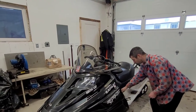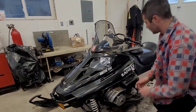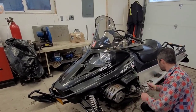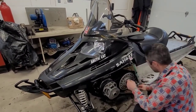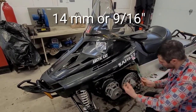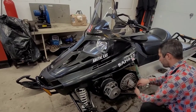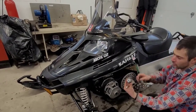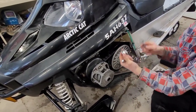So we're going to remove the belt, reinstall the new one, and shim it. Open up the cover — there are two bigger clips on the side here and this whole shield will remove. Put that aside. Then you're going to want to put the hand brake on here. With a 14mm or 9/16ths, you're going to remove this bolt, just like this. Pry the cap off like that. Notice that there's some shims behind this O-ring — we're going to get to that in a little bit.